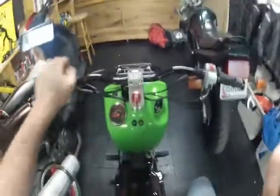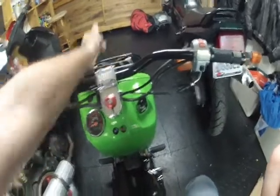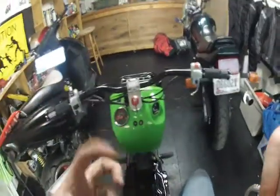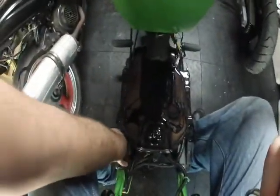The only other problem I've ever had with the bike is the rear brake cable. I put this through this headlight cage because when I had it inside the box, I guess there was too much stuff, and when you'd go all the way lock to lock it would push against the box. So I just routed this on the outside — they all come down through here.